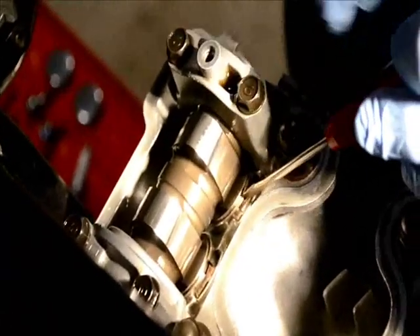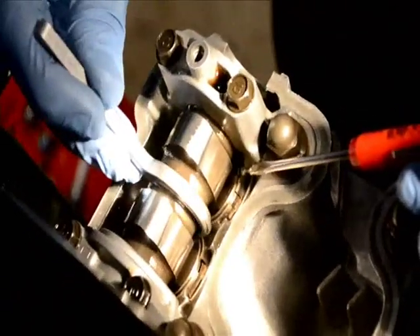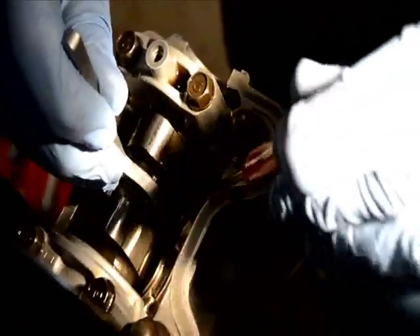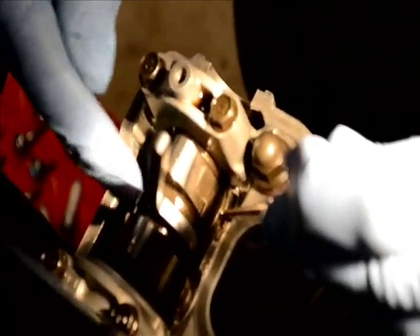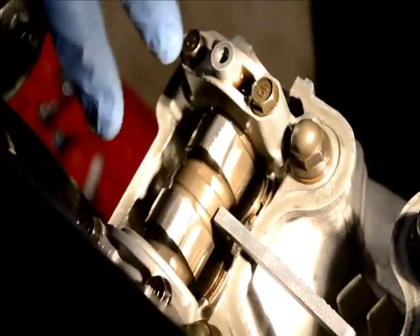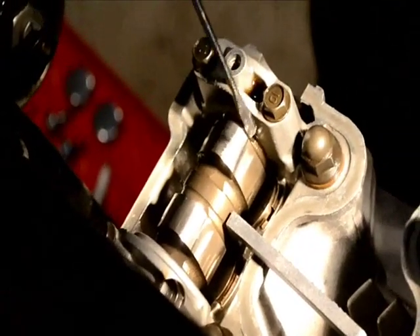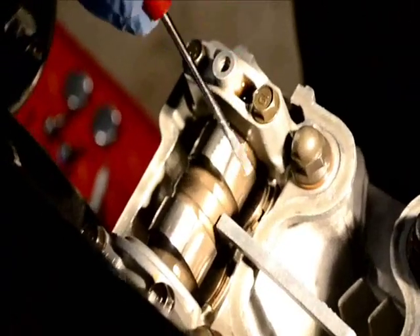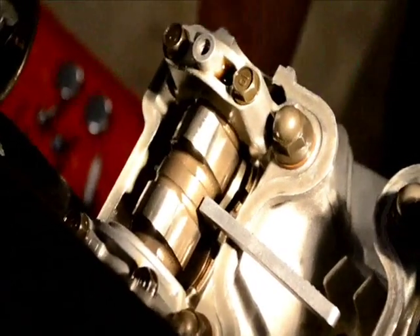When it's in this position the buckets are easy to move. I like to move the bucket to the front so I can pry the shim out easily. You stick the valve adjuster tool in between here — sometimes they spin so you hold it in place while it gets tension, since there's oil in there. You have to hold the tool really tight as it compresses both buckets down to the ground. Be very careful not to turn your engine at this point — the intake valves are in at the piston and you've just compressed the exhaust valve, so they're very close to touching. If it spins you'll bend them and basically need a whole new engine.